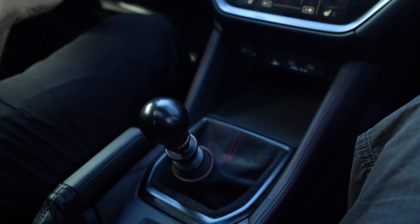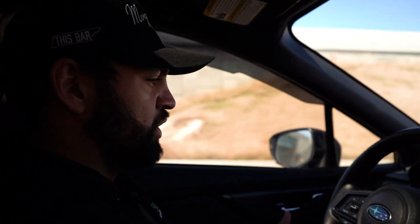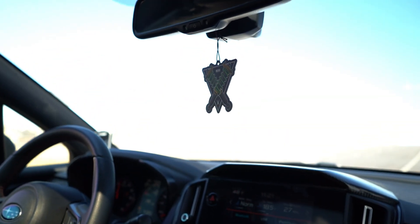I'm absolutely in love with the shifter — I don't know what short shifter he has, but it is notchy and it is perfect. I'm very impressed with the VB. So what we're going to do right here is just a little third gear pull once we get to the top, turn traction control off, about 3000 RPM. Very smooth — it's got a really good power band, actually, very consistent. A lot of cars you can feel them fall off as they get closer to 5500, 6000 RPM. This is just a very consistent power band at about 19 pounds.